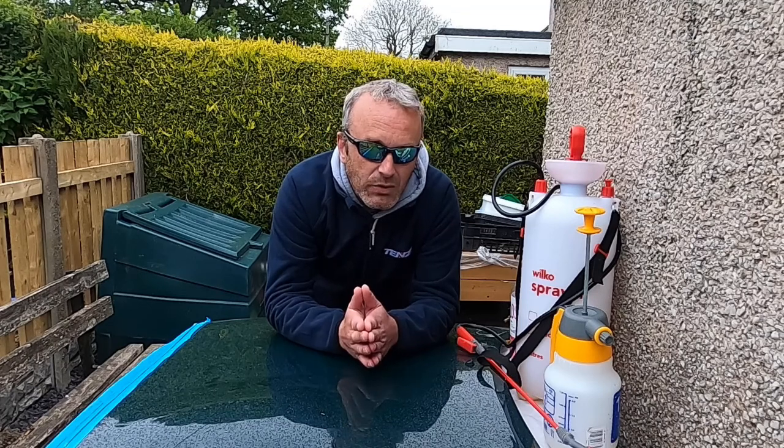So it all comes down to why we should invest so much time in cleaning our cars and putting waxes and sealants on. And this is the way I look at it. Whether you use a TFR or a citrus pre-wash, they are heavy degreasants, all right? And there is the scope for damaging your paintwork and plastic and trim. So the more last stage protection you can put on your car, a wax or a sealant, naturally affords you the ability to use a less aggressive cleaner, if you see what I mean. Okay, so if you're on top of your paintwork, etc., you can go for a citrus pre-wash, a pH neutral, nice and safe pre-wash that's not going to strip away your wax and all that kind of stuff. If you use an aggressive TFR or a super strong citrus pre-wash, there is the potential to strip off some of that wax layer, so you're going back as opposed to going forward.